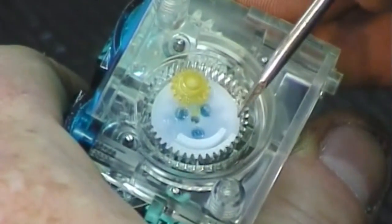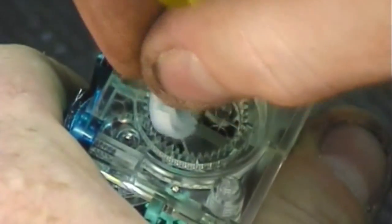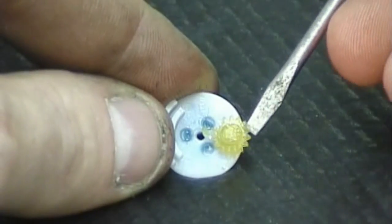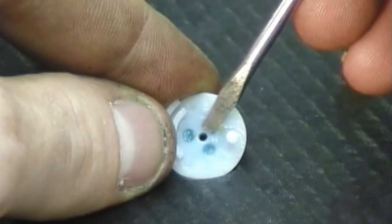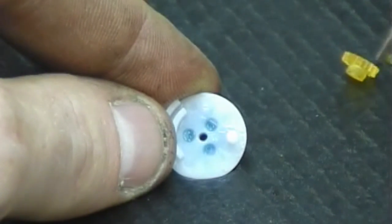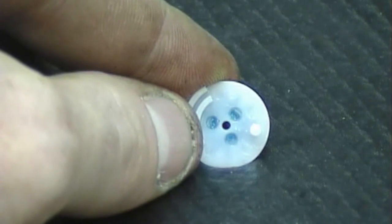Remove the white plastic plate that the odometer gear sits on. Go ahead and remove the gear from its plastic base, and be sure to take any of the broken gear teeth off as well. If the plate looks a little dry, put a touch of Vaseline on it as you install the IPD gear to ensure smooth operation.